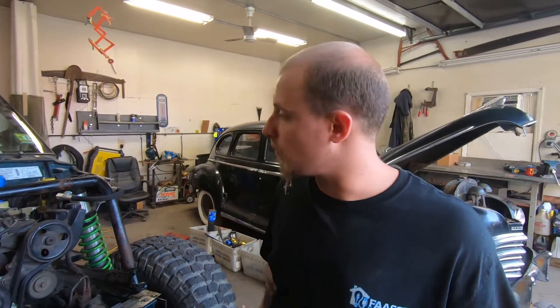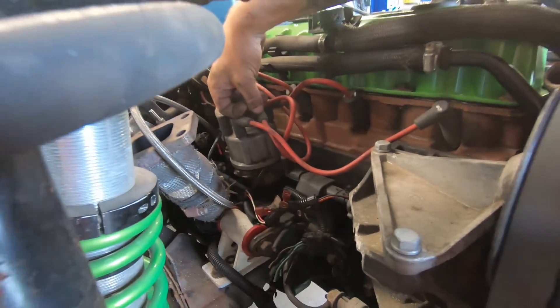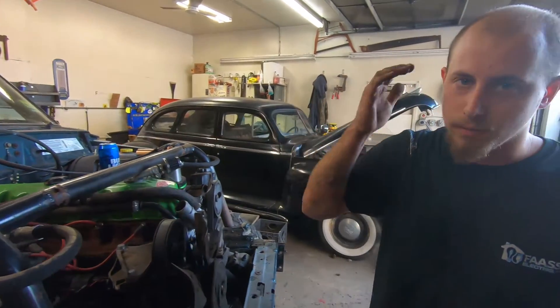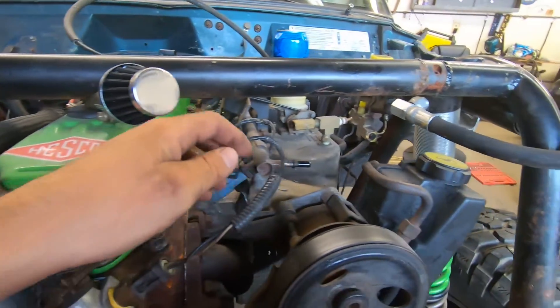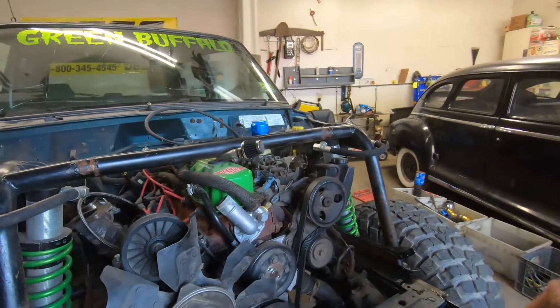Most of this video we were hacking fenders, but we also cut almost everything out. The distributor is going — we're replacing it with a cam position sensor from a newer Cherokee. Why have a distributor with MegaSquirt when you can run LS coil packs? Much smarter — we can have individual control on each coil and replace them so much easier instead of replacing that whole coil pack bar on the newer-style Cherokees. We have pigtails on all the injectors and we're going up to 80-pound injectors, a bigger fuel pump, everything new. We found a company that makes a custom fuel rail — hopefully it works out.